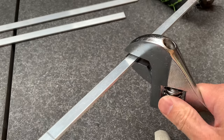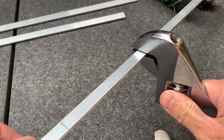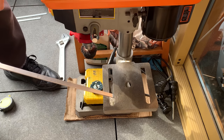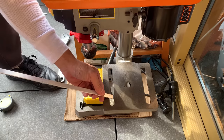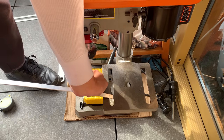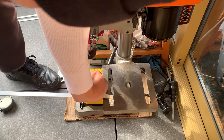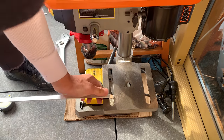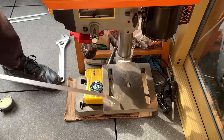You can use a shifter to bend it on the line and turn it, but I decided to use my drill press. You can also find any gap at your house to put it in and push it down. This metal bends pretty easy — it's just aluminum. I picked aluminum because it won't rust as much and it's easy to bend. You can also do it from steel if you want.